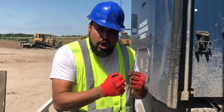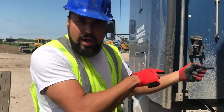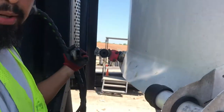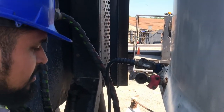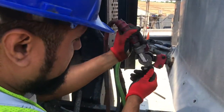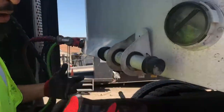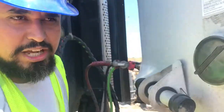When you heard that clicking noise, it means that the trailer got locked with the fifth wheel. Now we're going to go ahead and engage all the airlines again. Blue is blue. Green Phillips electrical. Red to the red air outlet. Looks like we're both in, looks like we're secure. Things are in — we should be good to go.